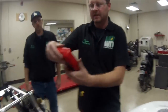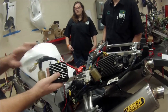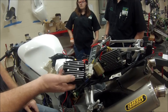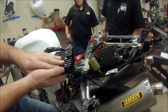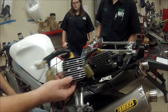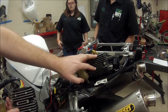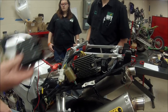What you can see through our testing is that for whatever reason, this aftermarket regulator rectifier — and we weren't even looking for a problem, we didn't have a complaint like the battery going dead — this would draw the battery dead super fast. When it's only supposed to be one-tenth of a milliamp and it was drawing one milliamp, that would definitely drain the battery a lot faster. The only way we'd really know how long is to leave it on there, measure each day, and see how long before the bike wouldn't start. But a great example of how to identify that: just disconnecting things, find the source, and fortunately we had a different one to exchange out. The service manual says to just replace the part — there's no test for this. When current draws like that, it's just replace the part. It's a problem, and that's exactly what we did.